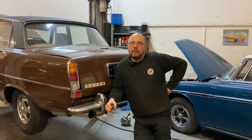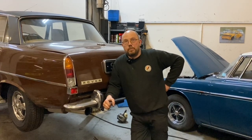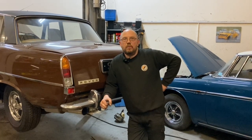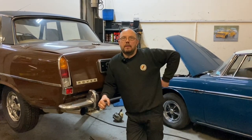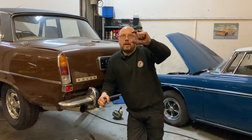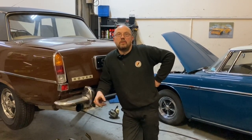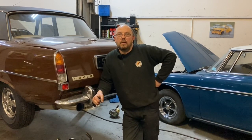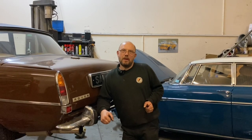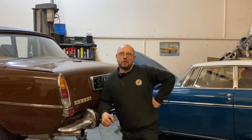Those are all the major sticking points and the biggest number of questions. Probably the most technically difficult bit is actually engineering the rear gearbox mount, but it's not actually that difficult. The last one we did for this car we cut down a crossmember from a TR7, used some spacers and some long bolts just to join it all up. That aspect of every conversion is different so it's a case of getting the box in, measuring up, and seeing what you can make out of what you've got. If you're interested in Rovers, check out our Rover playlist - like, share, subscribe and we'll bring you some more.